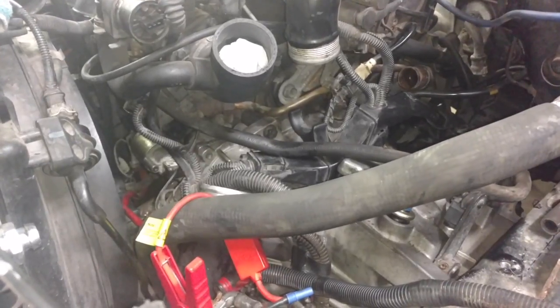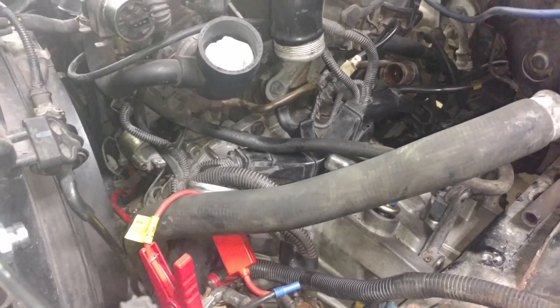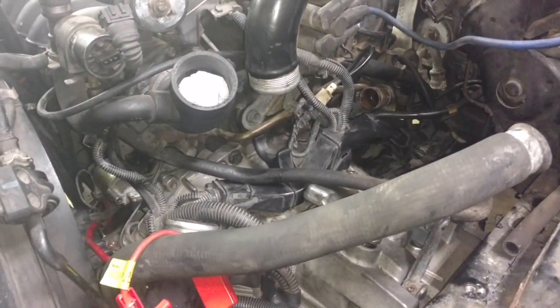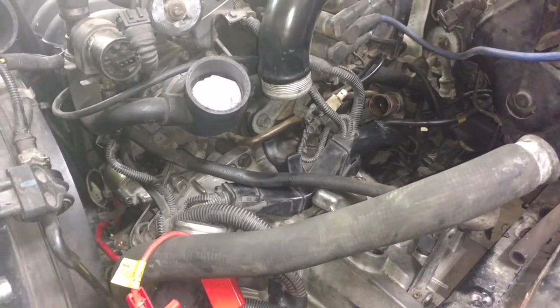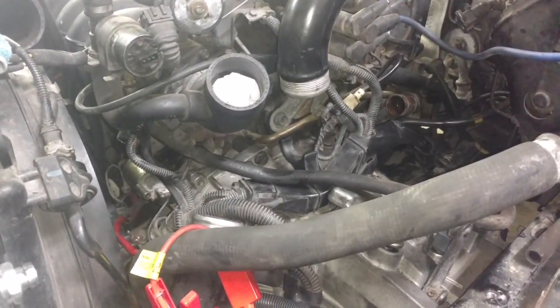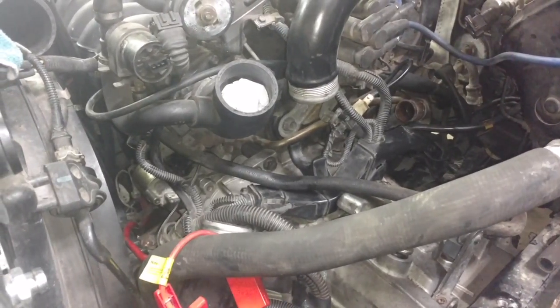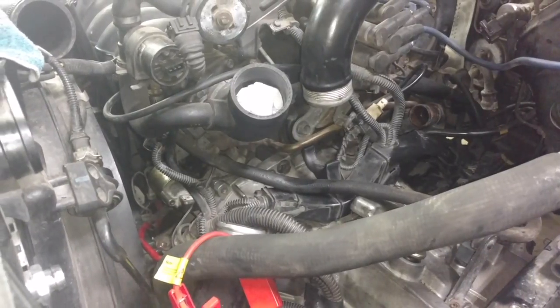Next, it's difficult. You probably need a jack, and a couple of people holding it from the top with a strap from the engine lift. Get that transmission up in position. Work it in the center of that transmission where your throwout bearing is. It has splines that have to go through that clutch.